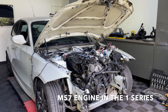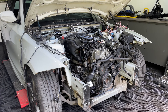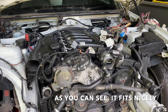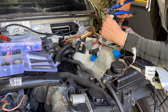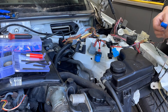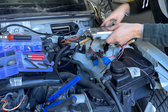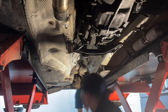Using an E9X chassis to start with will make your life easier. The one series and the E9X platform share the same front subframe, meaning the sump will simply slot straight in with no issues. Steering racks and the wiring side of things will also be easier. That said, we took this engine from an E60, which meant additional wiring, swapping the sump for an E9X sump, and also the engine mounts need to be M57 arms.